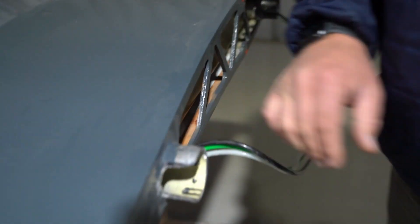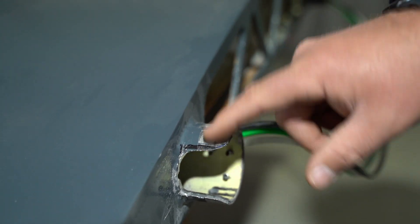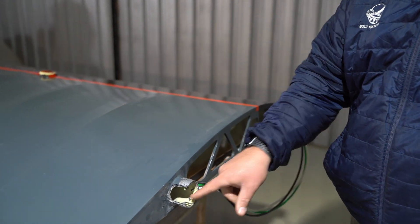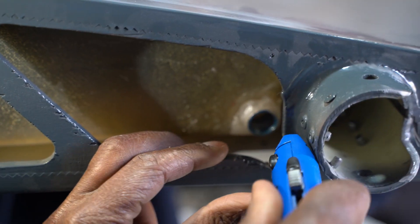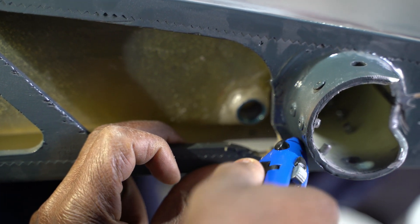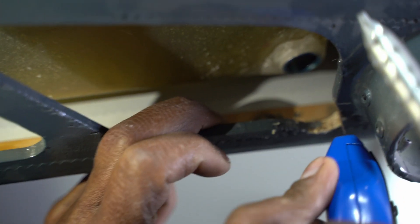When you do the cutout in the wing for folding, make sure you leave enough material between the bolt hole and where you do the cutout — about 20 to 24 millimeters. We're not going to paint with chromate right now; we'll just fit the wing, do the fuel lines, and touch it up with paint at the end. There's also something about the fuel strainer I'll explain.